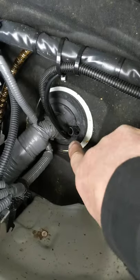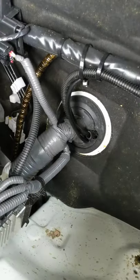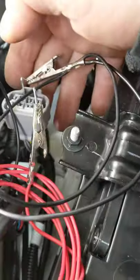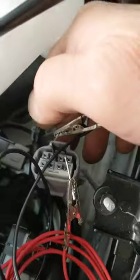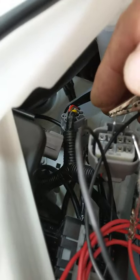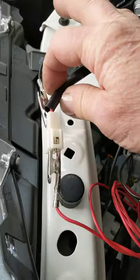This is another one, but mine are going around here and underneath the entrance of the main firewall grommet. Come to the plug here. Whichever way you orient these pins, these are the ones that you need to go into the relay input.